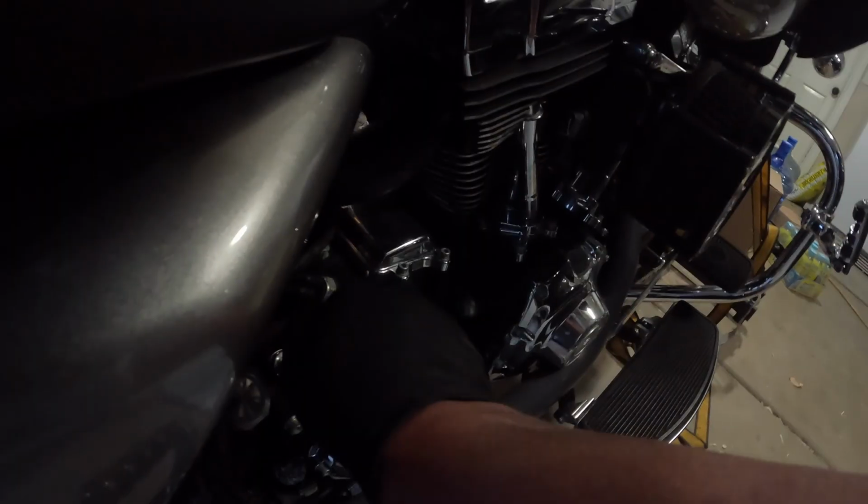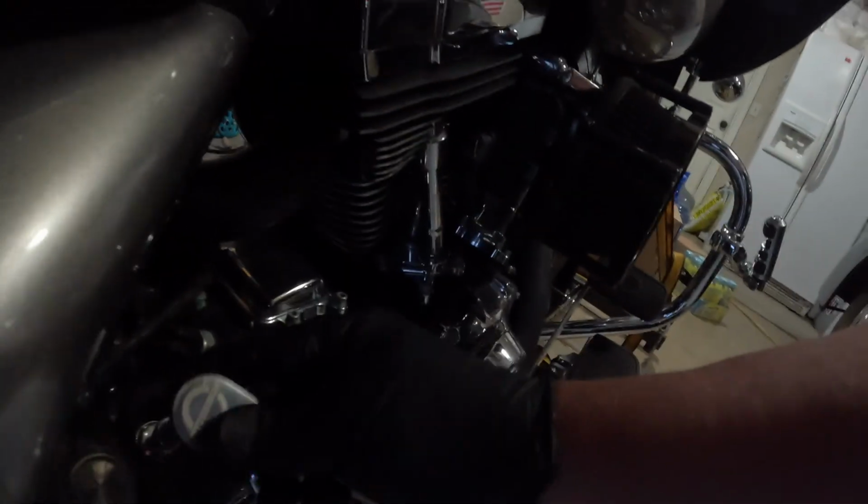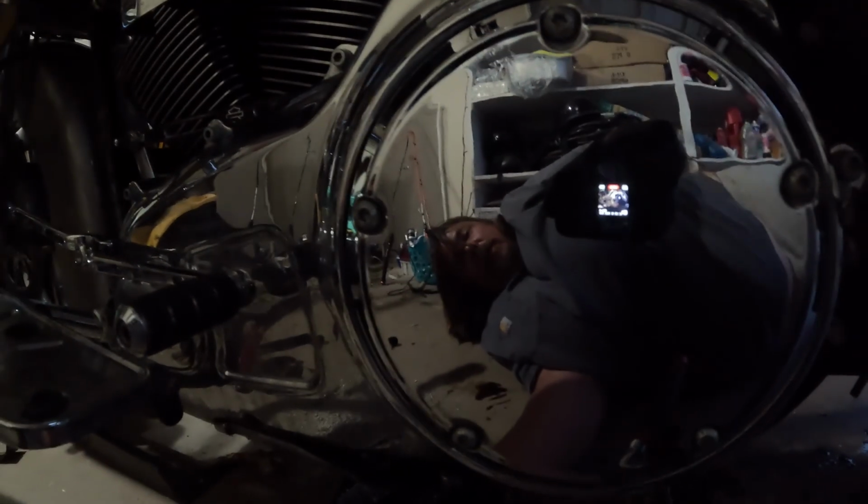So this is a 3/8. So yeah, and then grab your wrench. And I don't put a lot on that. I don't know, 10 pounds, 15 pounds. So we're done there. All right, the primary is right in front of it. It's just right here. It's another 5/8. The only way to make it drain faster is to take off the inspection cover, which is going to be T27s. So I'm going to get it draining and then I'll pull that off.